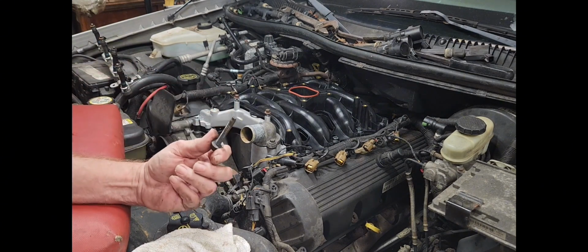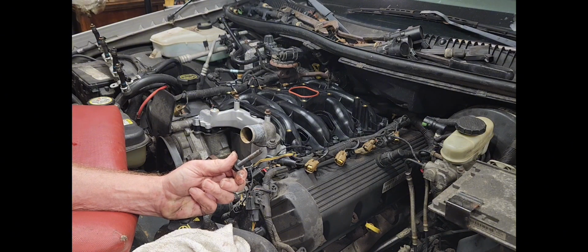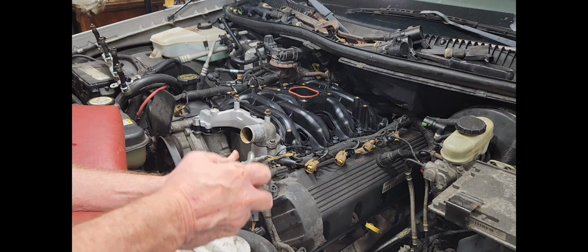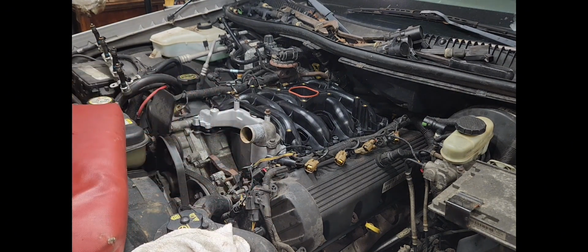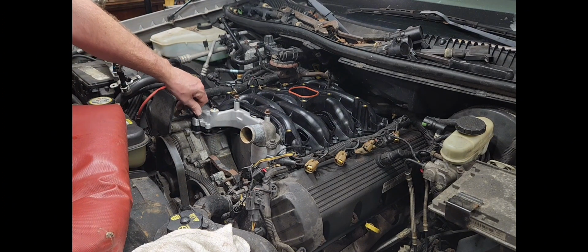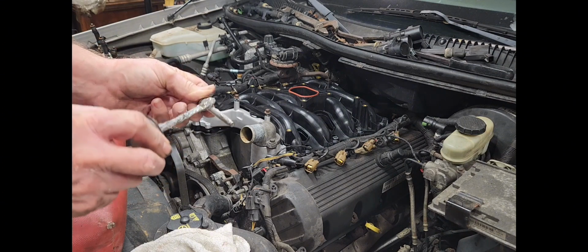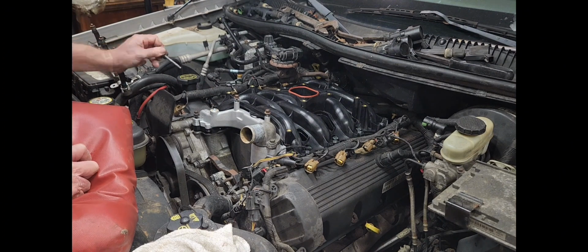You know, guys, remember what a pain these bolts were coming out? Well, got a solution for that. I'm putting some Never Seize on them. That's all you need to put. Won't have no more issues with them coming out. Just go along one side of them. Drop them on in.